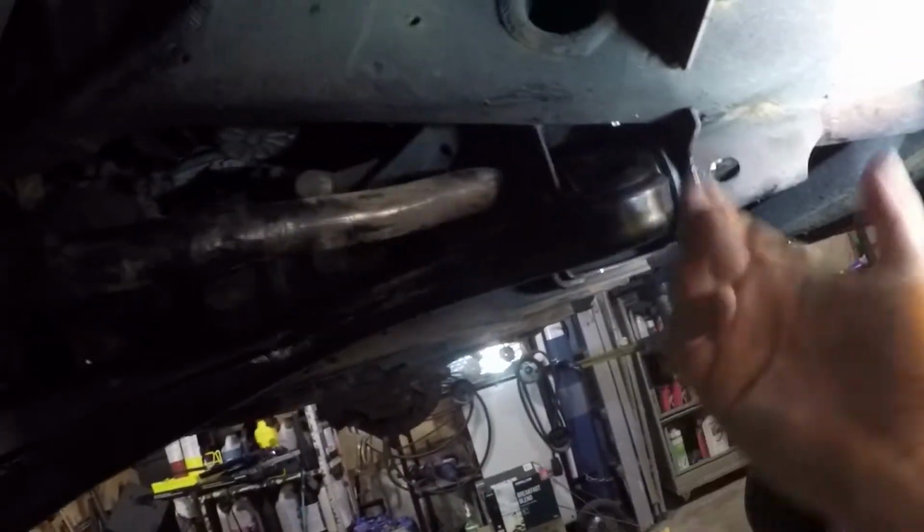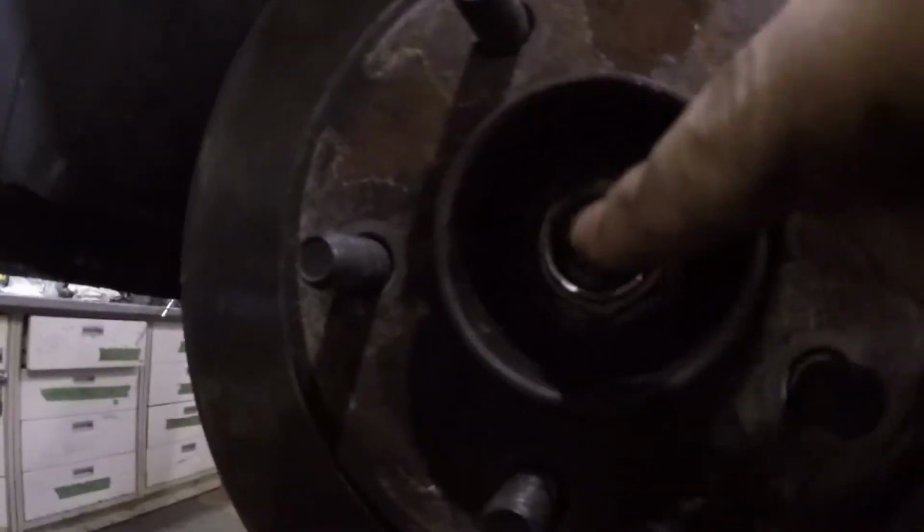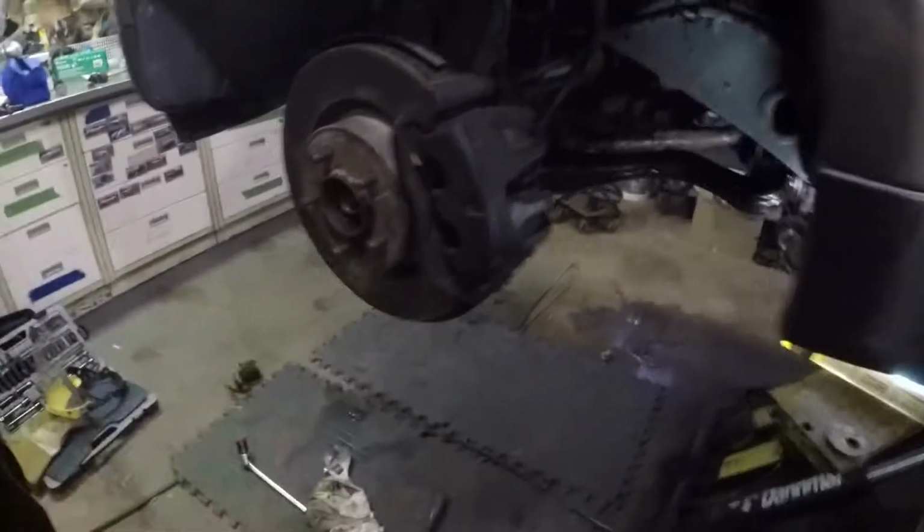We slid from underneath this and that part of the control arm together, put the bolts in, the studs, then the bolts in. We just hand tighten them. It's not adjusted yet. We didn't set it to the marks yet. The purpose of doing that is that the rest of the bolts, like the ball joint here that is underneath, the suspension that goes with this bolt, and the axle nut right there, we just wanted to tighten them slowly, one at a time, so that we don't run into any issues that the alignment is too tight on one side and it's preventing us to tighten something else. So anyways, we're doing great progress, so let's tighten the bolts one by one.